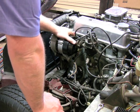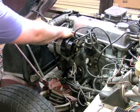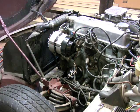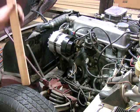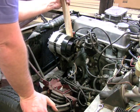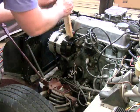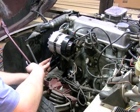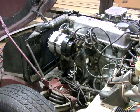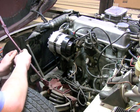One thing to remember is if you're putting a new belt on instead of the old one, your new belt may be a little bit tighter — that's normal because these things stretch out. Once you get your belt on, go ahead and pull it tight and finger tighten that bolt. Then grab your chunk of wood, put it right down next to the engine block, and just lightly put some pressure on it — you don't have to crush it. Then go ahead and tighten up that top bolt. Pull your board out and double check that your bottom nut is nice and secure. Remember, if you had to take apart your radiator to get a bolt out, don't forget to put that back in place as well.